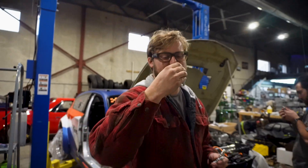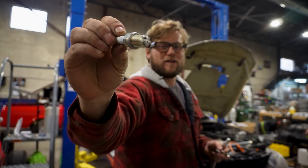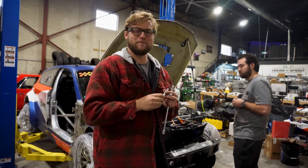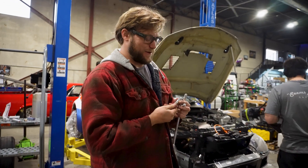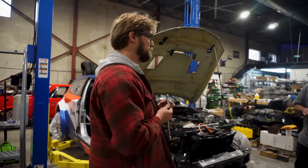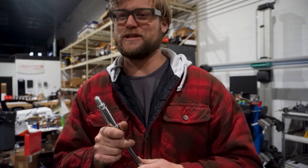BKR-7. But we're going to go back to the OEM one, which is like a four-pronger, because it's about a millimeter shorter. Chris measured it. And we're going to hope that the pistons don't hit the spark plugs anymore, and hope that the pistons don't hit the valves at all either when it's ripping around. But we'll see what happens. Good times, guys — it's always something.